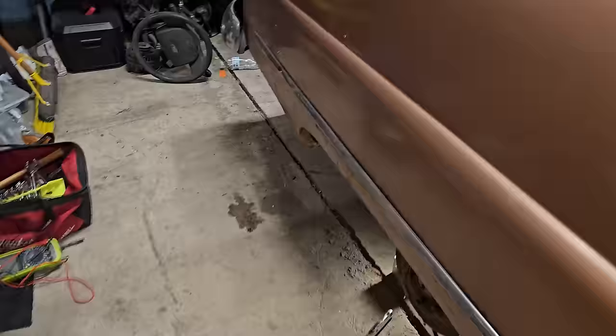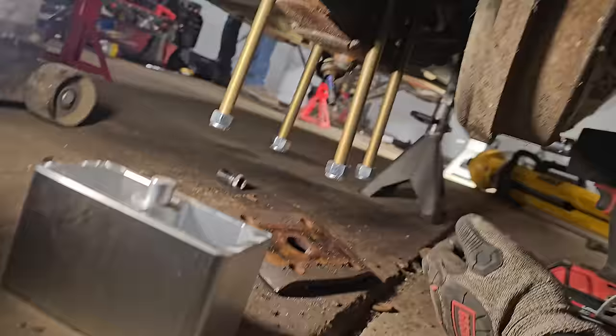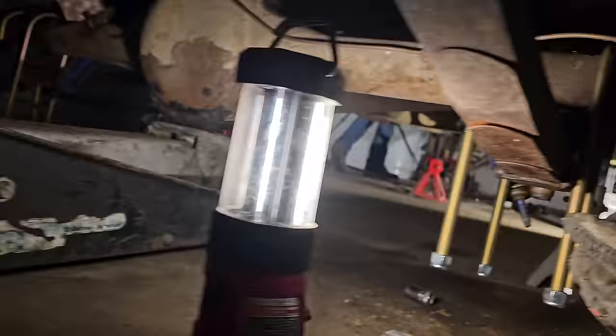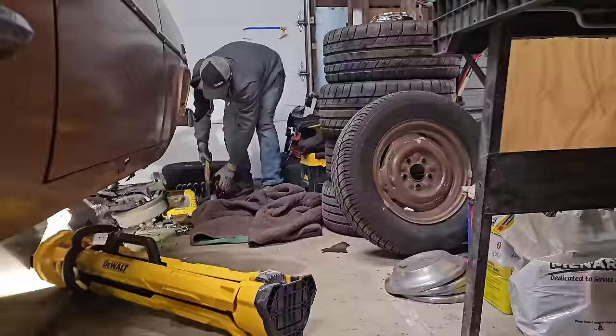All right, for you folks that are doing the back, it's a lot easier than the front. All you have to do is take this bottom plate out, and then put the new U-bolts in there and jack the pumpkin up and then slide the spacer right in between there, and you're done. And if you're doing the front like Sean, you have to do all this. Except you get hazard pay.